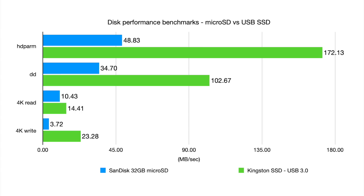I ran some benchmarks to get a sense of the raw performance difference between booting from the microSD card or the USB SSD. The first benchmark I ran tests the performance of sequential writes for large files — that's the first two graphs here. This is great for things like copying movies or big files, and the benchmarks show that even though the microSD cards are pretty fast for this use case, the SSD still blows them away. There's a link in the description to a blog post where I have the details about how you can run the same benchmarks on your own.